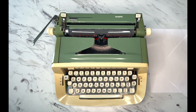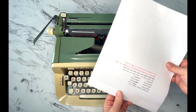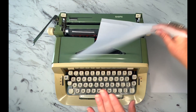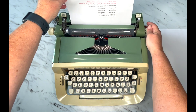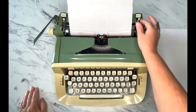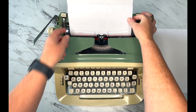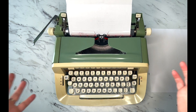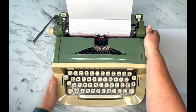Let's go ahead and load a piece of paper right here. I'm going to use a piece of paper I used earlier. If you've got typing on one side and want to type on the other side, put your paper in with the type facing you and it'll flip it over — there you go, loaded just fine, nice and even. If it hadn't been even, take the paper release, pull it forward to release the tension, move the paper around to get it even, then make sure you re-engage it because if you don't it's not going to feed properly.